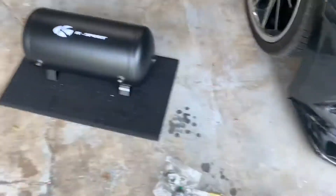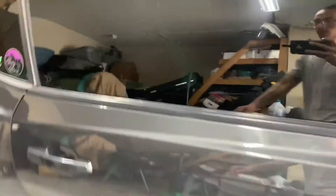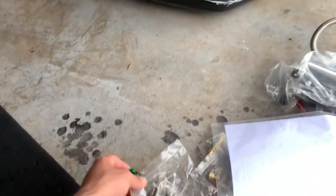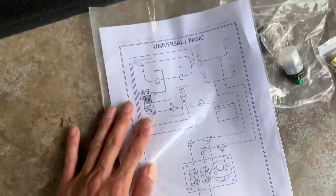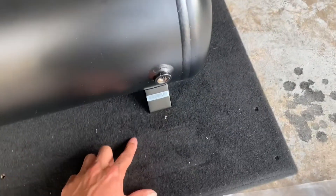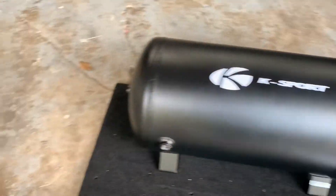For anybody who doesn't understand what I mean by old school: the new school system I have is the AirLift 3P — all controllers, all plug-and-play. With this setup, the pressure switch is what tells the compressor to turn on instead of a computer. You connect this to the relay and so on. K-Sport gave him this whole thing with spots for the compressors and all the ports here.